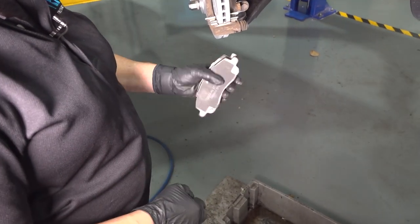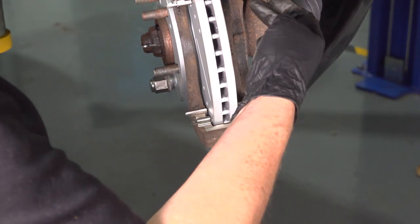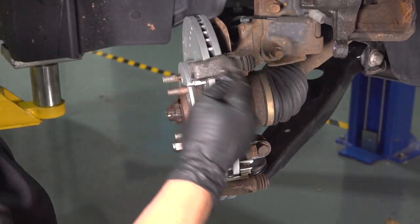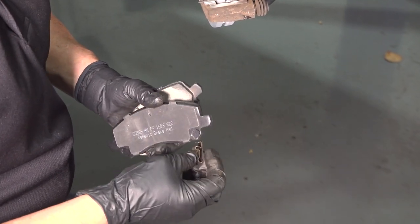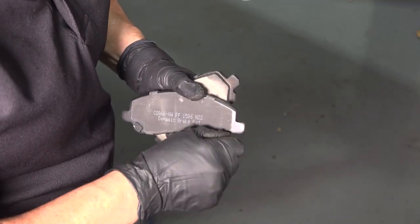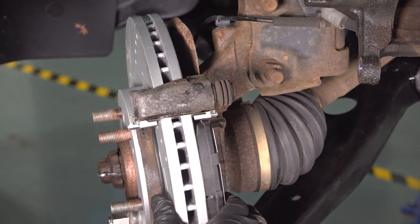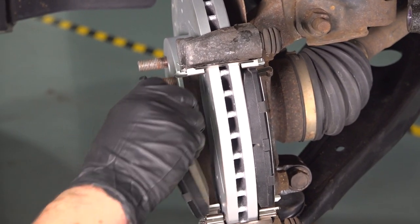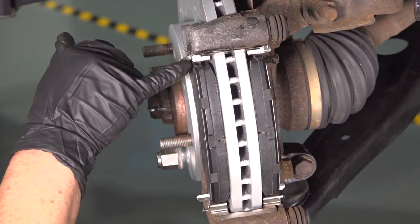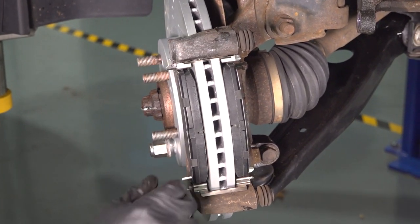There is no inner or outer pad, so you get to choose which one you want — they both have the grooves for the indicator to sit. The indicator is always going to go on the inner pad, and it goes wherever the caliper is positioned: if the caliper is in the front, it goes on the top, because you want the indicator to make first contact as it spins. Here's our new indicator that comes with the pad set — you just fit it right in that slot. Then we're going to slide it right in on those new tins and that bracket. Make sure it has a nice slide to it; if the pads are frozen in there and you had to hammer them in, these pads are going to wear at an angle. That is the perfect fit.